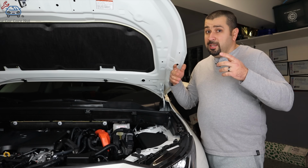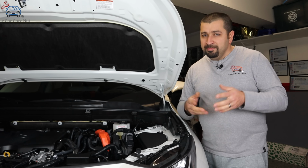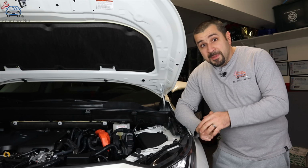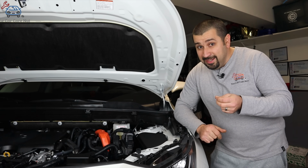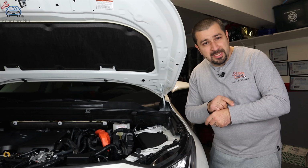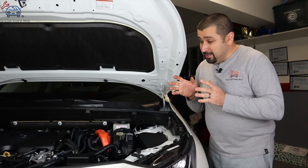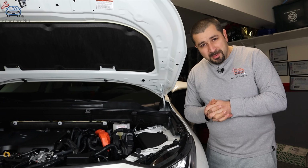Now you know. And one last thing before I let you go. Never jumpstart your hybrid backwards. Now, this sounds very obvious, but trust me, when it's 15 degrees outside and your battery died and you have kids screaming in the car and it's very cold and you really gotta go, that's the perfect storm to get you to not notice the red and the black and flip them. Happens to everybody, it's an accident, but make sure you pay extra attention, because with hybrids jump started backwards, we have problems. Serious ones.